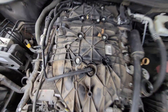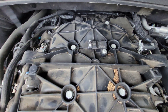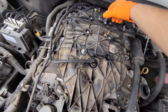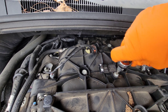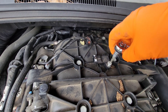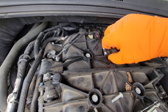You'll want to pop this electrical connector off — give it a wiggle and pull, it comes free. Then take your T25 Torx bit and loosen it, grab it, and just wiggle it out.